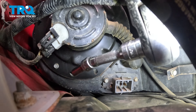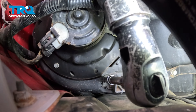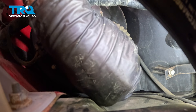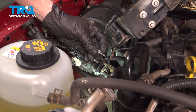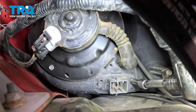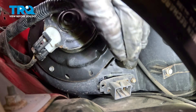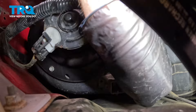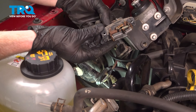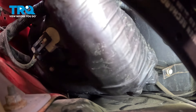With that out of place, let's continue on to our two 8-millimeter-headed bolts that hold the resistor in place. Inspect that mounting hardware as you remove it and replace it as necessary. There it is, friend. Let's make our way down in here and just clean up our area — just a quick inspection on that.